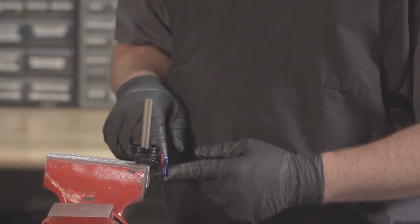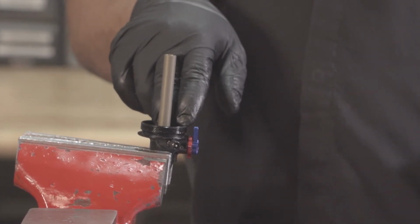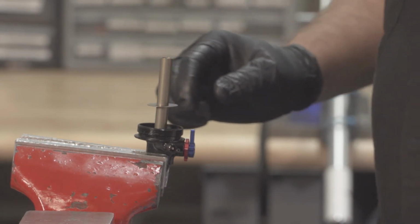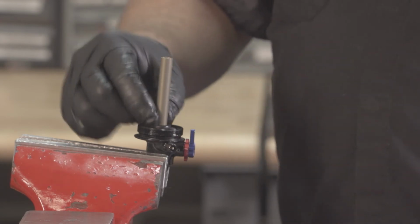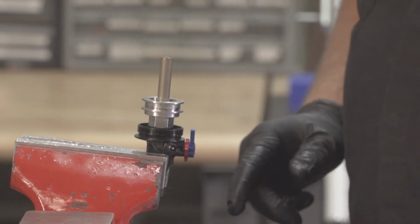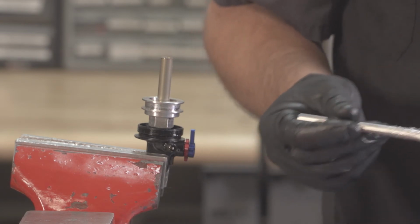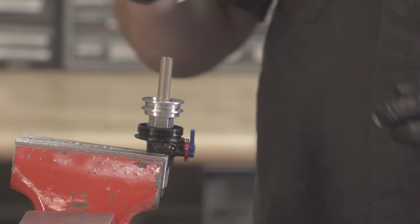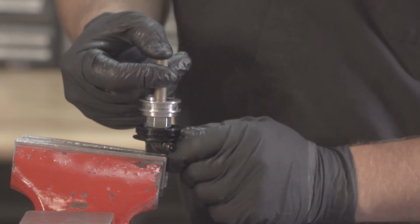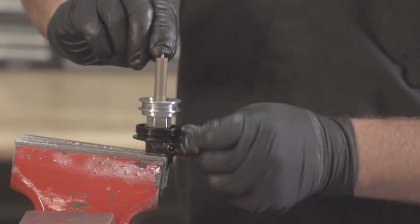If your compression knob is not freely rotating, you need to take a step back and reclock your shafts. From here, we'll reinstall our bottom mount washer, our new bottom mount O-ring, our seal head, and then a little bit of grease on our compression rod. Give it a firm seat and verify that the rod is moving up and down with lever movement.